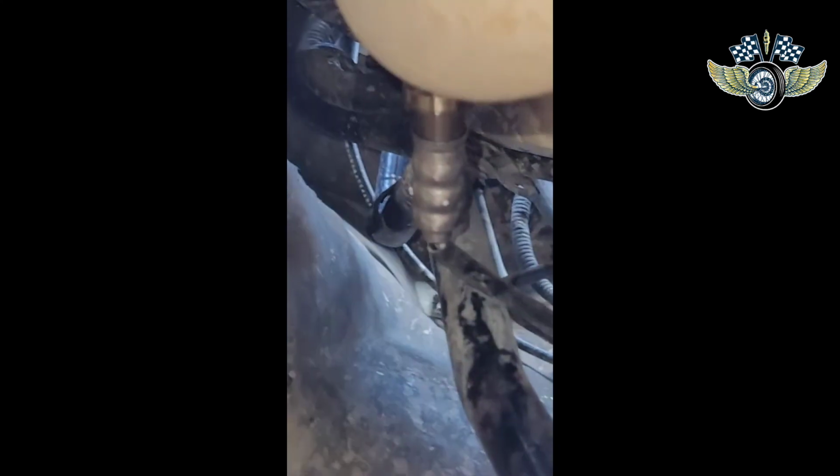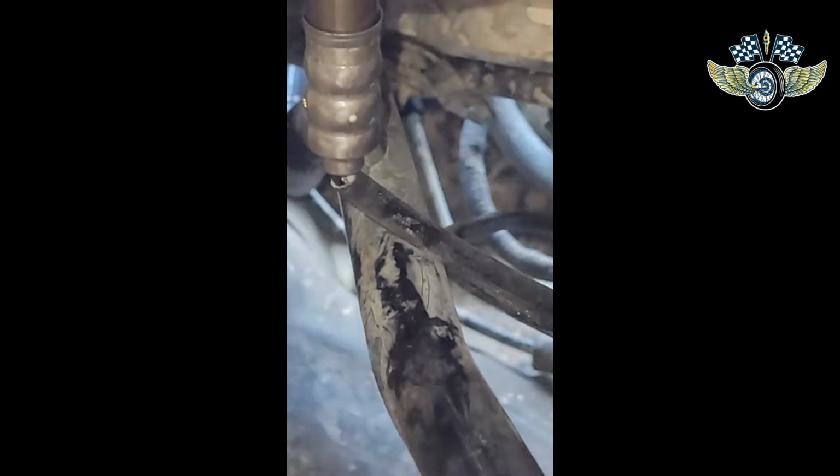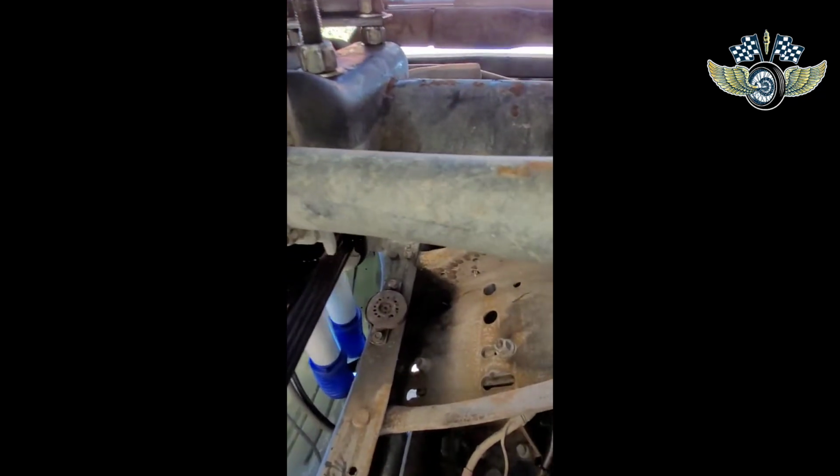So as you can see there, the O2 sensor's in. Nice and tight. It's run all the way to the top. Just make sure you zip tie it away from any exhaust or heat. And that'll pretty much do it, yo. As y'all can hear, it's active today. The sun's out, so everybody's gonna be out.